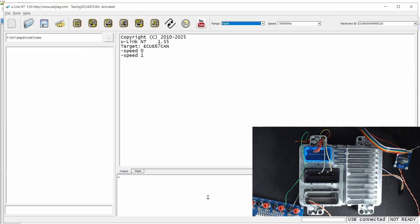This target will handle both master and slave. For the master flash, we can both read and write. For the slave, we can only do write — I'll show you that later. So first, for the master, we need to go to the ECU itself and go to the debug arm. Once you enter debug arm, you are able to do the programming.